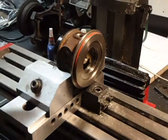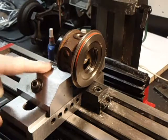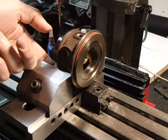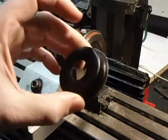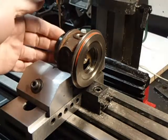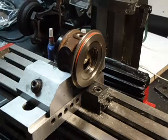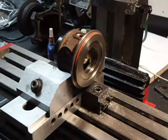So there's the setup in my little mini mill. Here's the cartridge housing — it's in a screwless vise. I've got it on some spacers here to space it up on the flat surface of the oil return. One important thing: if you're putting a turbo back together, do not forget this little shield back here before you put the turbo shaft in. My bearings are already in there, and I've got the little brass plate in there too, so that's already together. It's got new everything in it — new bearings from when it was rebuilt.